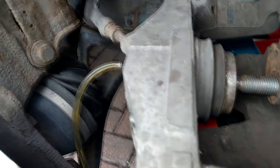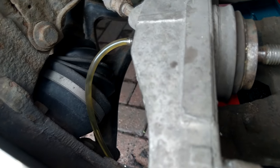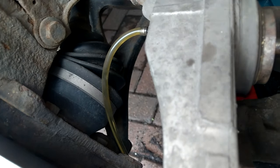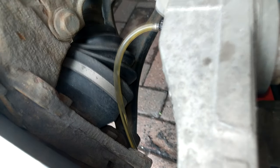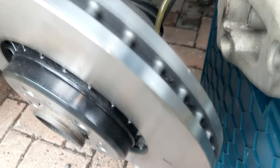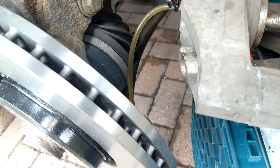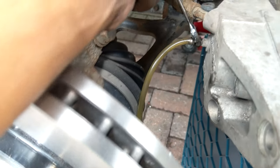Doing it this way means you squish out all of that really crappy fluid rather than pushing it back into the caliper to give it a second chance. You don't want this fluid having a second chance — it's done its job. Of course there's nothing wrong with doing a complete brake fluid refresh, but if you are going to be winding in a piston you may as well just crack off the bleed nipple and eject the worst fluid. Once the piston's fully retracted, tighten up the bleed nipple and the piston's in the correct position for nice new thick discs and pads.